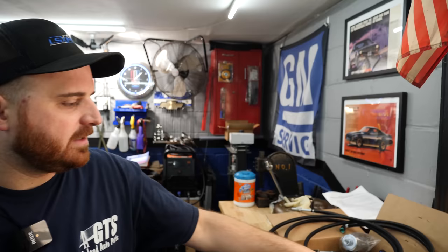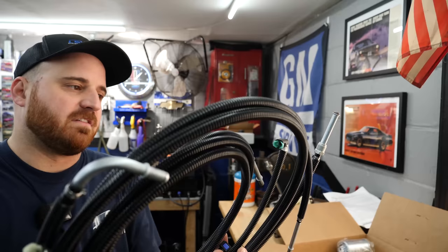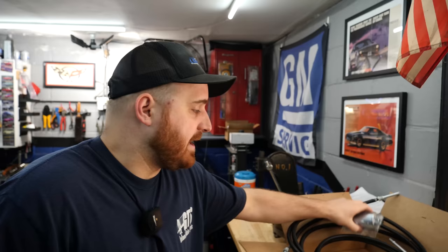What I have here is this kit I found off of eBay. It costs about $150 to $160 and it's pretty much a plug-and-play fuel line kit. It replaces all the hard lines that go from the tank to the engine, just with nylon — that regular GM kind of plastic fuel line. This is going to replace all the rusty stuff and it has all the OEM connections on it. All we have to do is disconnect those hard lines from the top of the fuel pump, disconnect them from the rail, and just plug these in their place. It also comes with a nice fresh fuel filter.